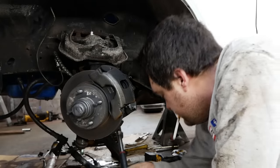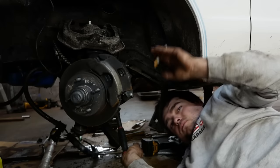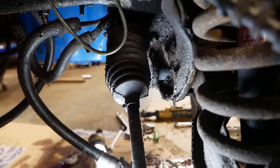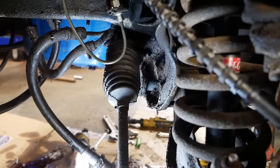All right, we got that crossmember out of our way now. Now I can get on the bolt that goes all the way through the rack. Pull about the backside, and the rack will just fall right off, right? Yeah. Oh, God. We got it off there, but the bushing shell is stuck on the bolt. I need the bolt to come out just a little bit so that rack can drop out.